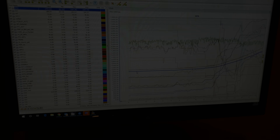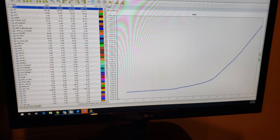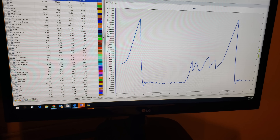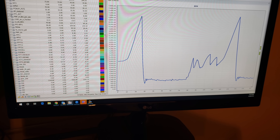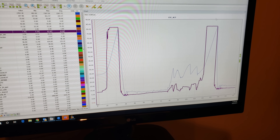The customer says log 23 is 91 pump gas and log 24 is E85. I'm going to show you what it looks like on my end and give you a general sense of how we look at it, how it selects timing, and how it learns the ethanol content. I'm pointing the phone at the screen to look at this gentleman's data log. He said this one was on 91 pump gas — you can see him go to the pedal, not just once but twice as he's driving around.